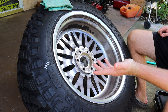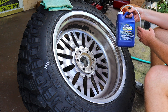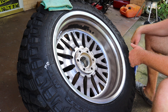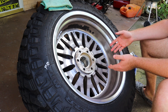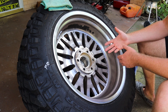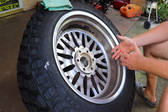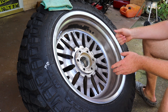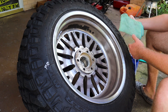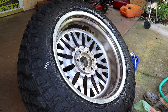We have to clean it first since the back of this wheel was probably last cleaned three months ago. What I like to use to clean aluminum wheels before polishing is Star Brite Ultimate Aluminum Cleaner and Restore — it's about $20 on Amazon, link below. It opens up the pores in the aluminum, making it easier to polish. I've noticed washing with it before hand polishing makes the results even better. Just use an old microfiber because it's straight acid, so be careful.